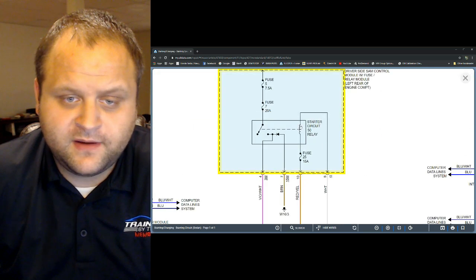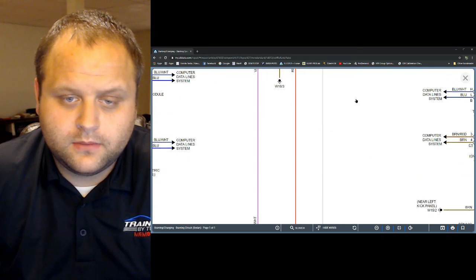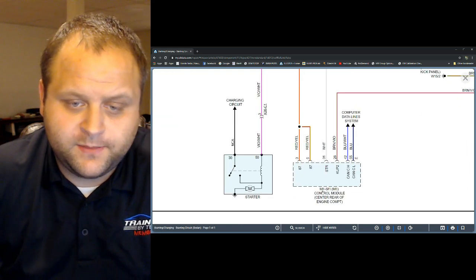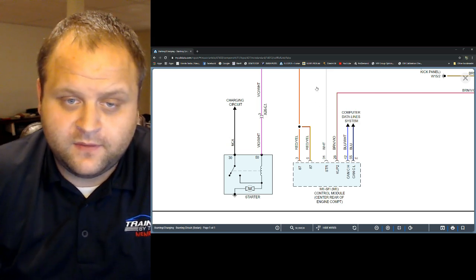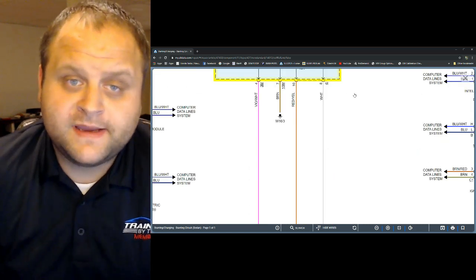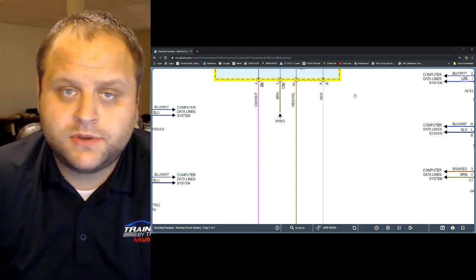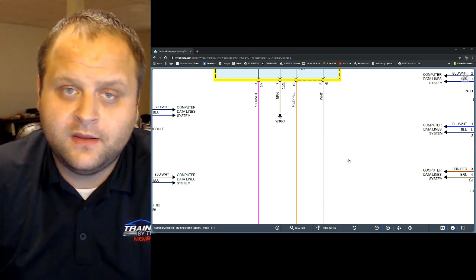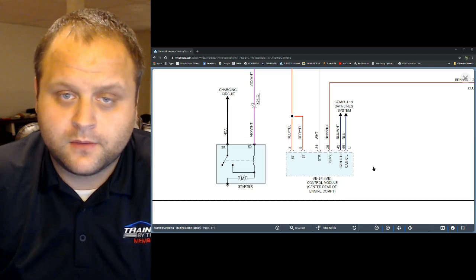And then the control side of the relay, you have a battery plus and a ground, both coming from the engine control module, the ME-SFI. Essentially, the engine control module is what provides the power and ground to this starter relay. So if there were any immobilizer faults or shift interlock problems, trans range sensor problems like that, that would all be determined prior to the engine control module grounding that starter relay.